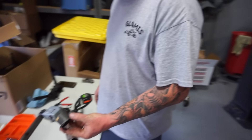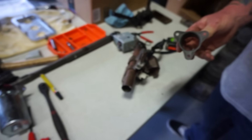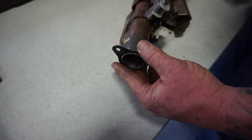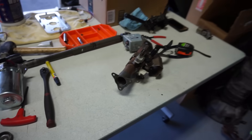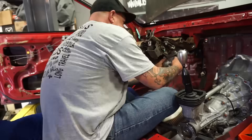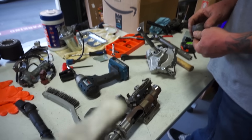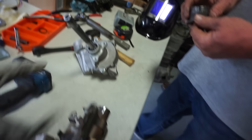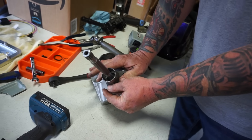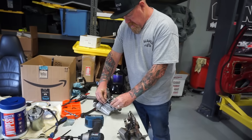As you guys saw, I just chopped down the collar that Harvey brought that bolts onto the power steering rack, and we've also chopped down the other end, which is our factory steering column out of the EK. That is from the donor part for the slide over the rack. So now this slides over and we've got our custom length, and then our power module actually just bolts directly to this tri-pattern, which is pretty cool. Quick update: we've shortened down the original steering column, the original steering shaft, and the new shaft that's going to be connected to the old shaft. Also shortened the collar that's going to be mated to our original steering column to make this all one unit.